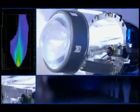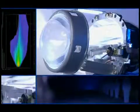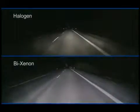In the raised position, the shutter produces the prescribed cut-off for dipped beam light. When lowered, it makes room for the main beam light. Unusually wide and intensive main beam light is the result, for better safety on open stretches of road. In the case of Bi-Xenon, the main beam light is the same colour as the dipped beam light.